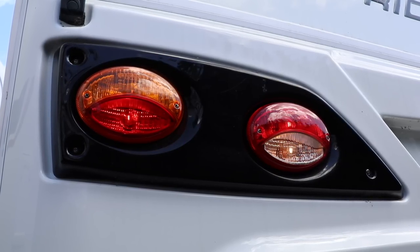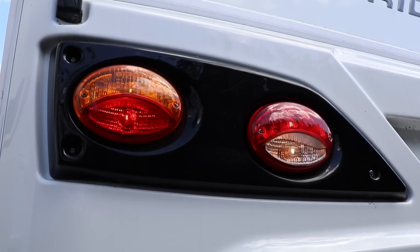The last check is that we're going to switch everything on. I'm going to put the car into reverse, have the hazards on, side lights on, foot brake on, and fog lights on — everything activated. This will weed out any potential earth problems or connection issues, and also loads up every single light bulb so if you have a fuse on the end of its life, it'll go now, because we're going to load up the full system with everything going at the same time. Everything's illuminated — I'll tell you what, it looks like a crap disco back here! That is the lights now completely checked — everything is working, everything is as it should be.